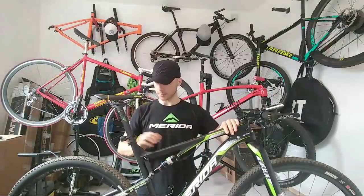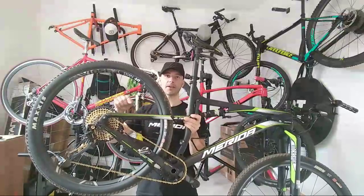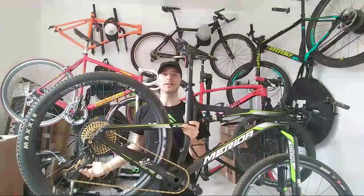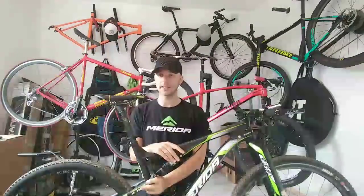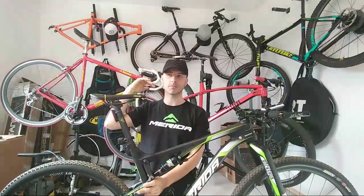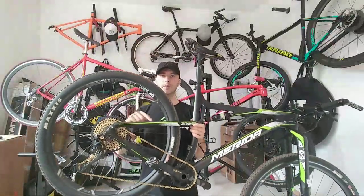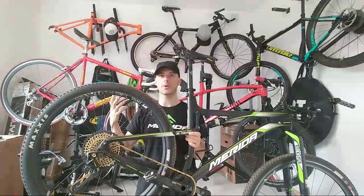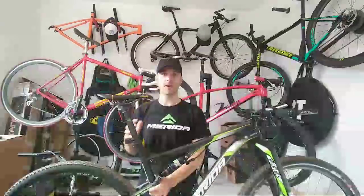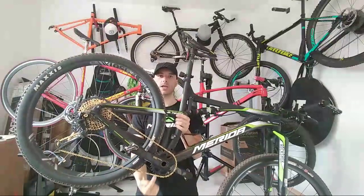The second thing in specializing the bike is also the components. For example, this bike has an extremely specialized 1x12 drivetrain. You may love it, you may not like it. If I was still, let's say, 16 years old, I loved riding long descents and long hours in the saddle, and then a 1x drivetrain would not work for me at all, because you can spin up to 48 kilometers per hour and that's it. And me and my riding buddies would go very often 60, 70, 80 kilometers per hour. So we would need at least a 2x drivetrain, so 2 chainrings in the front.